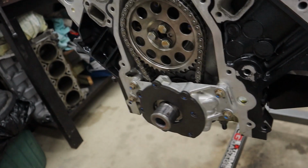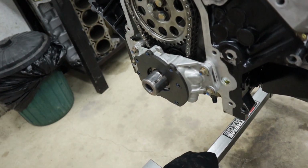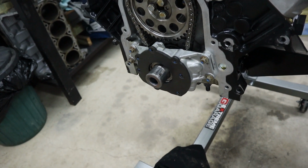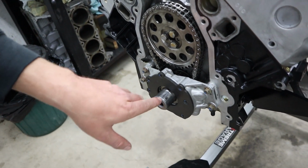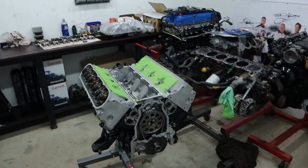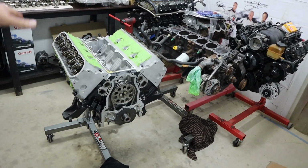Our new crank pulley, which is keywayed, is handy because we actually have a keywayed crank because it's aftermarket. So we're still going to pin it as well anyway, rather than just rely on the one key. We're going to pin it as well. So Rex will probably do that today, I'd assume. Yeah, a few little things like that, which I'll just show you when we get back in, and I'm back here tomorrow. But hopefully then this thing will be just about ready to go on as soon as we put our valley plate and our supercharger on it.